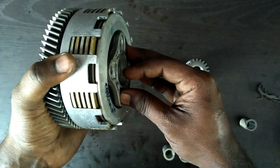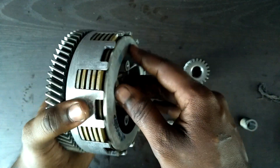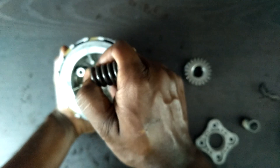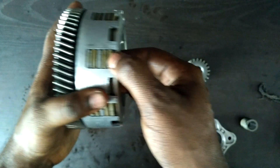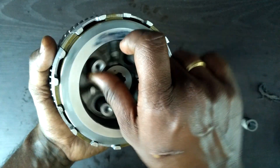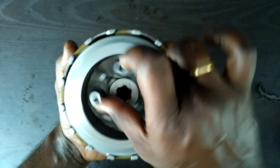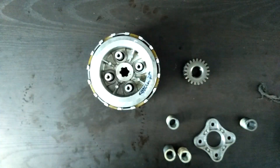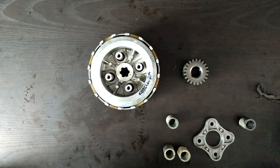When you depress the clutch lever, there is a cam which pushes inward, separating the clutch plate and steel plate — effectively putting a force against the spring to separate the steel plate and the clutch plate, which in normal condition are always compressed together. When we effectively separate them, the drive gets disconnected, so the gearbox is disconnected from the engine. That is the basic principle and working of a clutch assembly of a motorcycle. If you like the video, please subscribe and share. Thanks for watching.